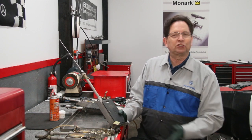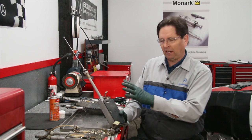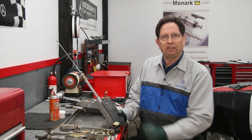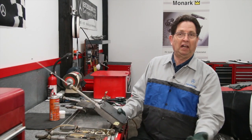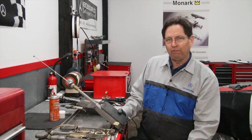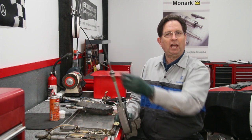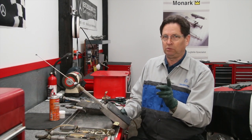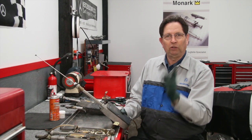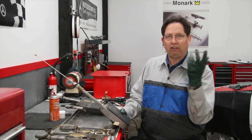Between those two-year service cycles, there's one very important thing you need to do: keep your antenna mast lubricated. If you have the correct quality lubricant — I say every time you fuel up — use Hirschman antenna lube. That's the only kind you should use. Don't use grease or oil; that just attracts dirt and will jam the mast.